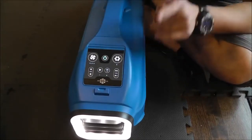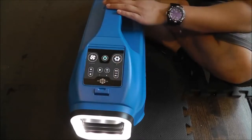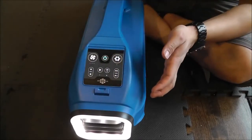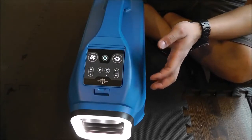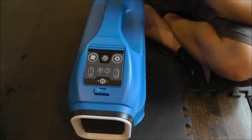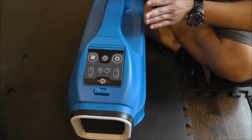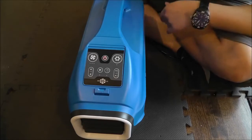So that's pretty much it, but now let's go ahead and test out the battery. I'll go ahead and shut it off. It's now in standby mode — you can hear the compressor fan. The condenser fan is still going to run to cool the system down for a little bit. If I hold it down again it should now shut off completely. When it stops blowing I'll go ahead and unplug it, and then we'll try out the battery.